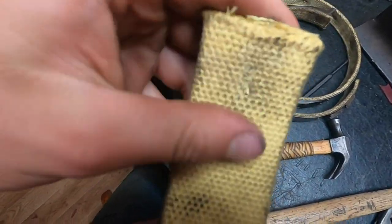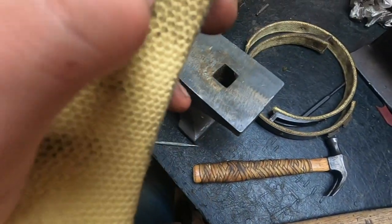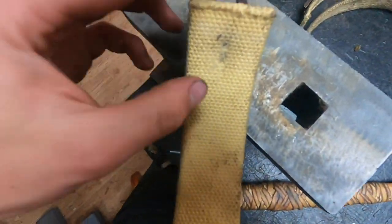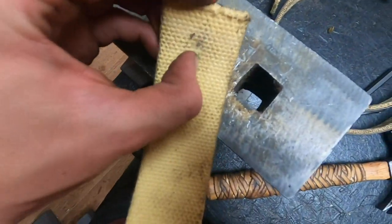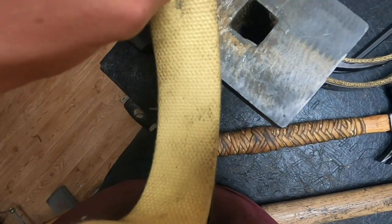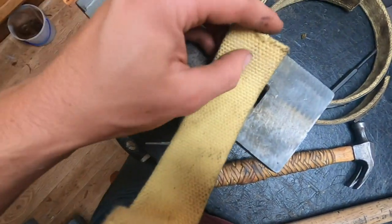so that none of that rivet is going to be rubbing when this is on the transmission. So we've got a good depth on both of those and a wide split. And these two top rivets are obviously the most important because that's at the top of the band. It's the only thing holding this band from getting folded in. So I've been trying to make sure that the top ones are really good.